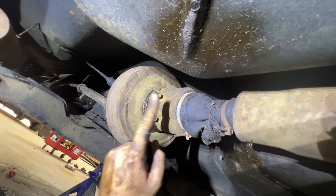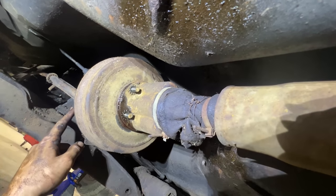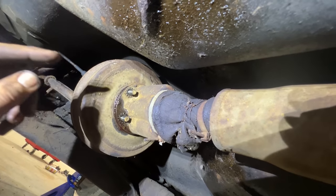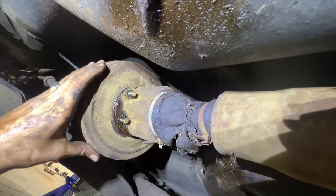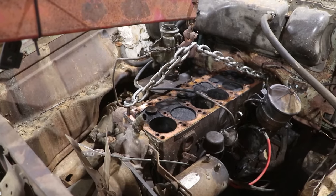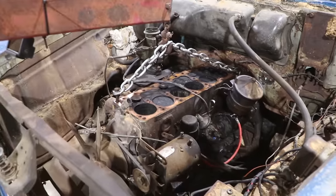Here's a fun fact of the day: these early Chryslers used what's called a ball and trunnion driveshaft. On top of that, this transmission does not have a park function. It actually has a drum brake on the tail shaft of the transmission with a cable that you pull to lock the car in park. Chrysler changed that around '62 when they went to an actual park lever in the tail shaft. But this is how they did it back in the day - stick it in neutral with the push button and lock it down. Pulling an engine - it never gets old.